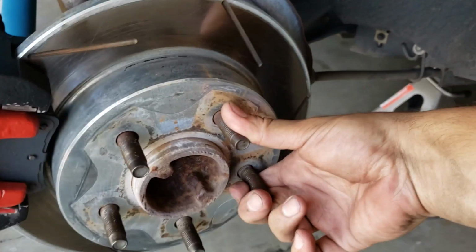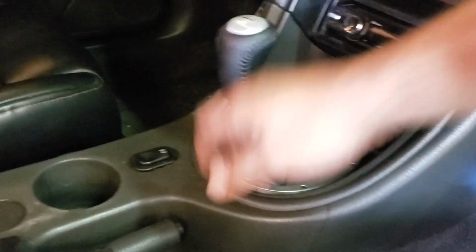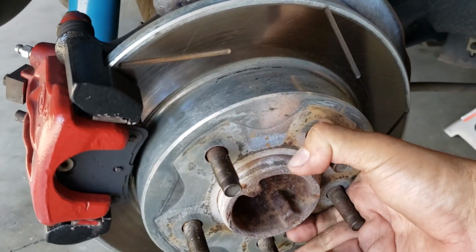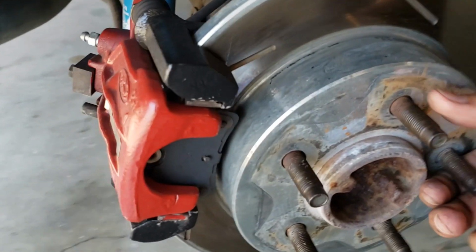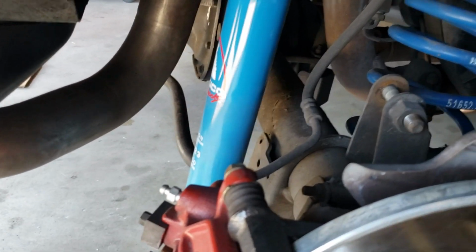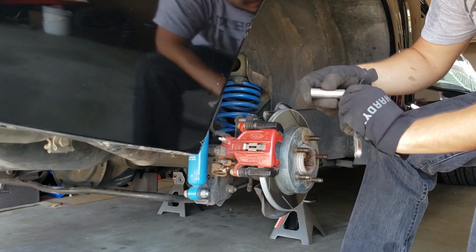But I also wanted to point out how I have it on neutral, no e-brake, and this is so stiff. It shouldn't be so stiff. So that's probably one reason why this car didn't feel too powerful. Maybe the discs inside the rear end gave out, but we'll find out. I'll do the same test once I have the other rear end. It's gonna be a 15mm socket.